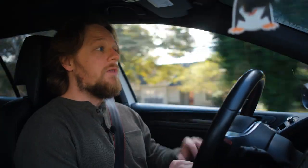I love the fact that they come with all new bolts because you kind of need to do that anyway. They're stretch bolts. I actually was curious, like, oh, they're stretch bolts? How much do they stretch? And you can actually compare them side by side, the new and the old, and there's about that much of a difference. They do stretch. So you do need new ones.